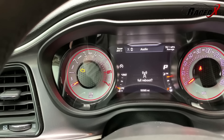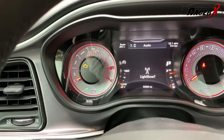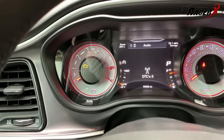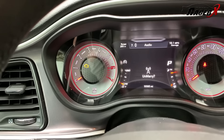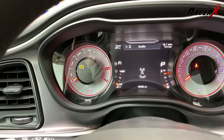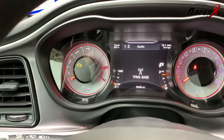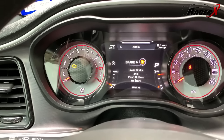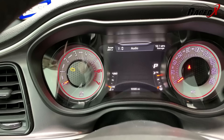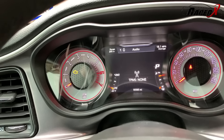Then you can start navigating through. There's an option to do a full reboot and lots of different options here. There are three different options on the light show, which I can show you in a minute. If you are somebody that wants flashy lights, this thing will most certainly do that. As I click through, you can read your codes right there. Lots of different options — do you want to unmarry it? No. You've got performance pages if you want to bring those up. Here's the tire setting: as I mentioned, you can actually turn your TPMS sensors off. I'll hit the OK button and it lets me choose the base setting, premium setting, or if I'm at the track, I just hit none — and now the TPMS sensors are completely disabled.